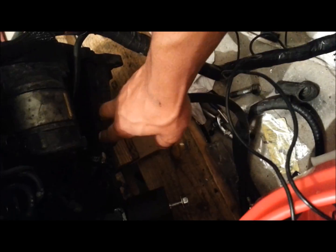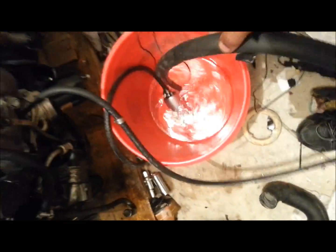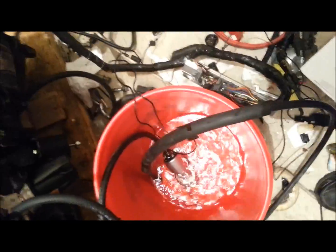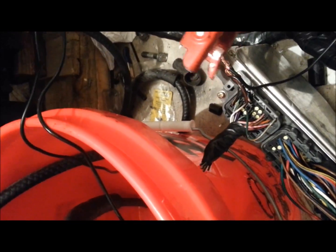I put in the fuel pump. The fuel goes to this here — this goes to the engine underneath the starter, and this one is the returning fuel line coming out from the engine. As you can see, nothing is connected to this yet. Now I'm going to connect the fuel pump — you can hear it. I'm going to connect the wires to the positive on the battery, and now I'm going to take F1 from the loom plug and connect it to the positive.